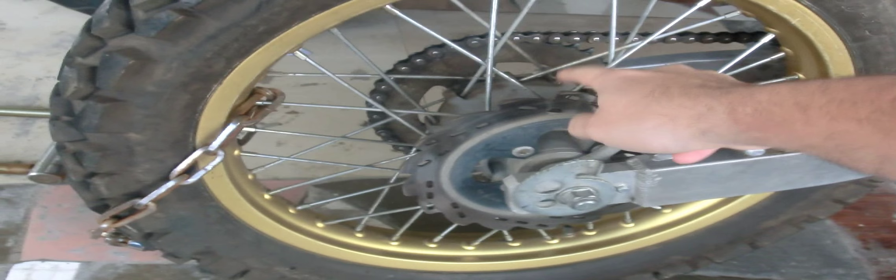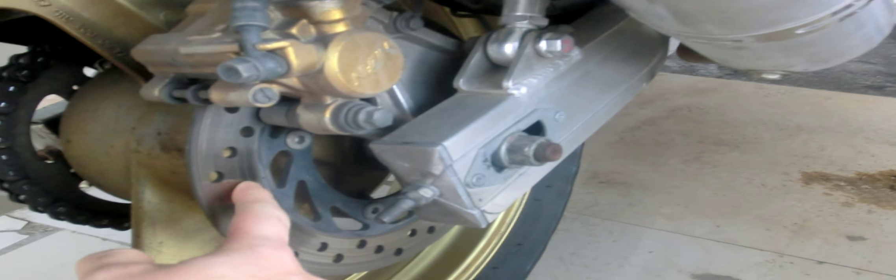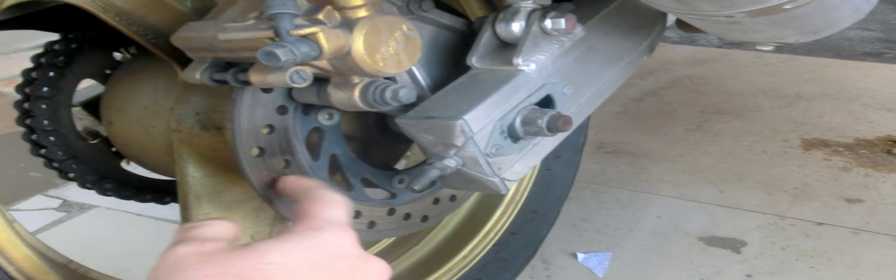This crosser has a rear disc brake — you can see the caliper and disc. The master cylinder for that is over here. On my CB, the rear is a disc as well — this is a ventilated disc brake. The holes allow it to cool down quicker, because when braking heavily the disc gets very hot, and the holes help the heat dissipate. Here is the caliper.